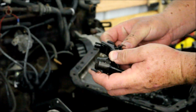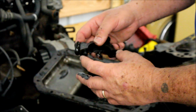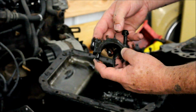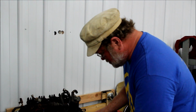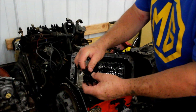So what happened was this thing was rattling. It began to rattle because the bearing failed, and as it rattled, then things stretched. The bolts stretched, and once the bolts started to stretch, they unwound. I've discovered in 40 years of doing all this stuff that when bolts rattle, they always rattle loose. They never rattle tight.